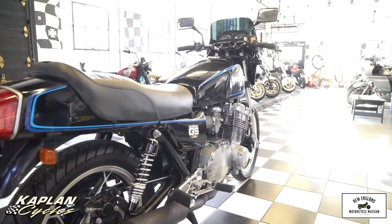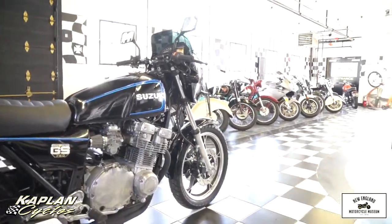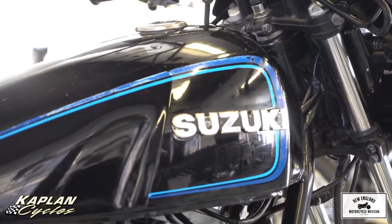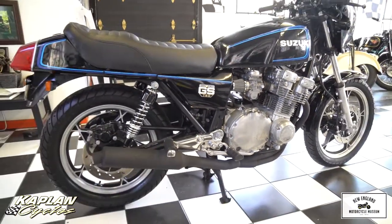So let me go over the parts list with you again. NGK spark plugs, 4. NGK spark plug caps, 4. Brand new top of the line Yuasa battery. A gallon of Maxima 20W-50 premium oil, top of the line oil. A brand new high flow oil filter with O-ring. 14 millimeter crush washer for the oil drain plug.